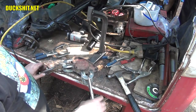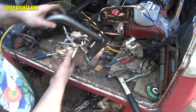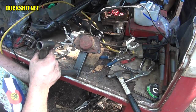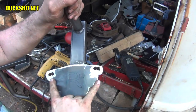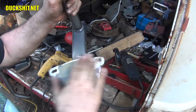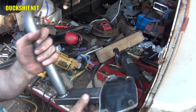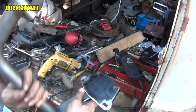I figured the best approach would be to go ahead and get these clamped together to get the holes lined up, and then I welded them on there. So that plate is now part of the tool, which makes it a whole lot easier to drill the holes out without worrying about this thing moving around. I like the idea of welding it — it ain't going anywhere now, and everything looks to be lined up. That came out good. You can see my two additional holes — I made some wings to wrap around it. These two holes kind of figured themselves. This is the right-hand side. This will work for all Type 1 platforms, Type 3, as long as this is long enough. It'll also work for people converting split window buses. The cover fit over it just fine.